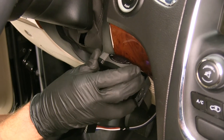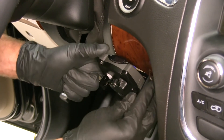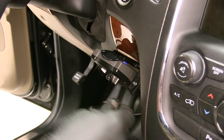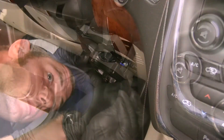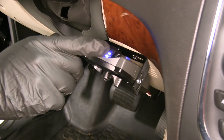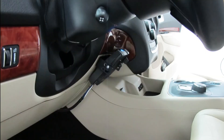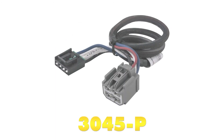We'll want to keep in mind there is a dial on top of the P2 that we'll want to get to, and also on this side a little blue button for your boost control, so you want to make sure you've got room to get your fingers in there. The lower hole on the front is going to do the job for us. I'm going to use the machine-style screws with the finer threads on each side. We'll use a Phillips bit — it's a little tight on this side so we're using a right-angle driver to get that installed. Then we'll take our pigtail and plug that right into the back of the controller.